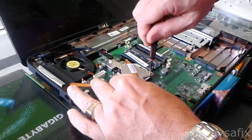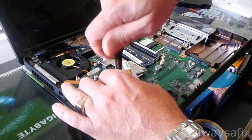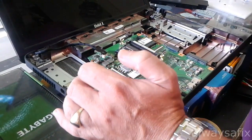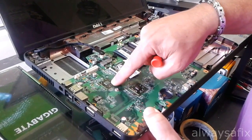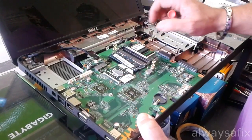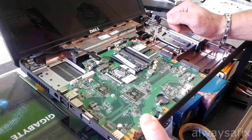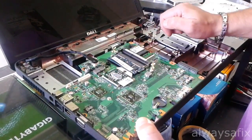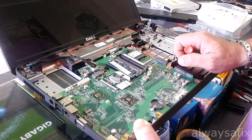Unplug your screen. This is the IGP, and this is the one that has overheated and is now causing that beeping problem. So we're going to try and just reflow it first and see how we do with that. If that doesn't work out nicely, we're going to have to send this motherboard away and have this chip re-balled — which means the chip will be removed from the board, all the solder balls underneath will be replaced, and then the chip will be re-soldered into the board. It's a more permanent fix.